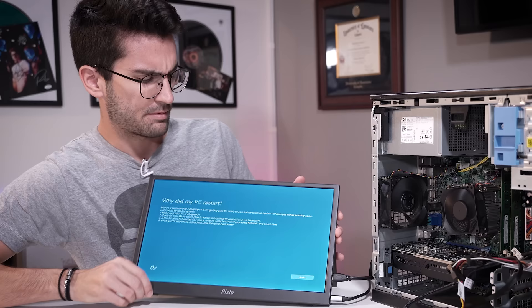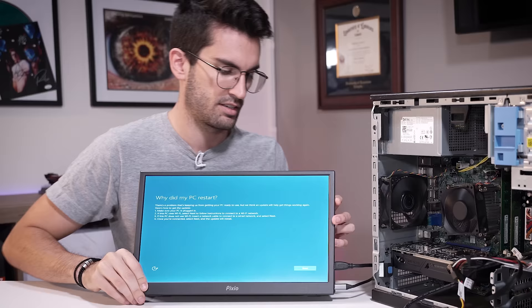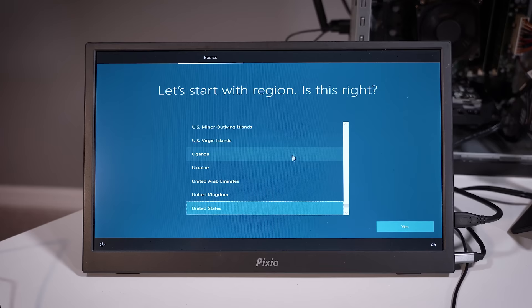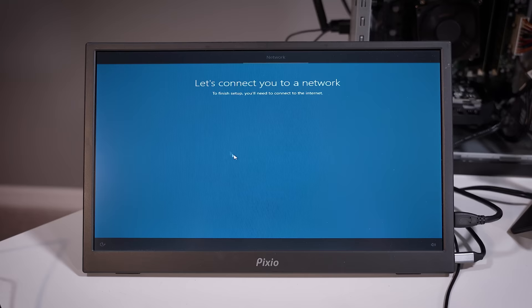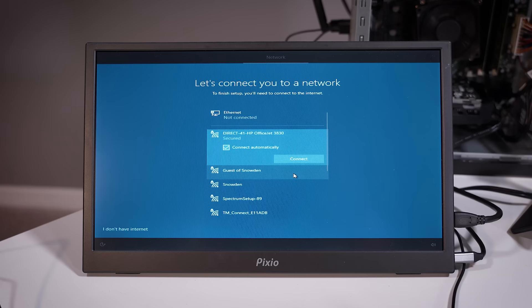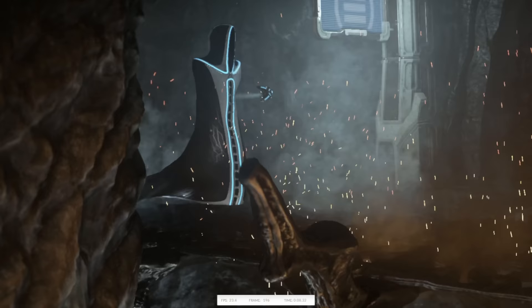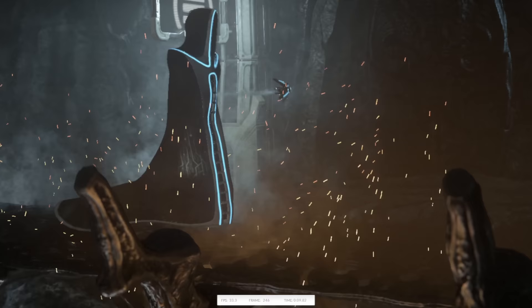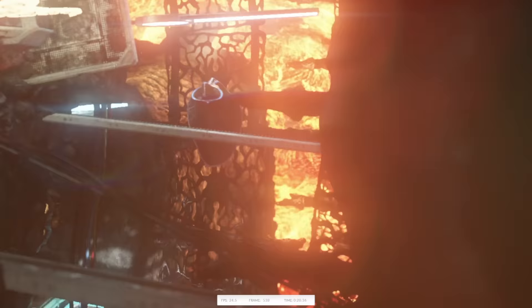The PC restarted — there was a problem keeping it from getting ready to use, but it just had to run through an extra prompt or two. Kicking things off with 3DMark Firestrike, it doesn't look all that smooth, which is pretty standard for lower-end systems in a benchmark like this. It's a synthetic load, so it's going to be pretty heavy on both the 1050 and our Core i5 — which is actually a third-gen Core i5, a 3470, not a fourth-gen like I initially thought.